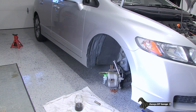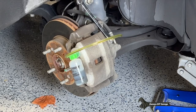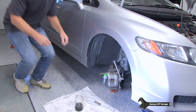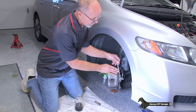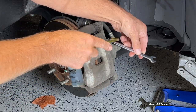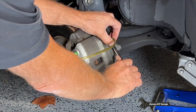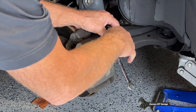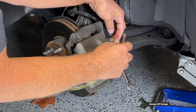The bottle looks like I could do two more. All right, so here's number six. I'll let it up. And then here's number seven. And I'll let it up. All right, I'm gonna go ahead and close the bleeder, and look how clean that fluid is there. Very clean fluid. Bleeder's all tight. Those air bubbles are because this is loosened up right there.